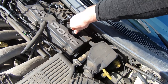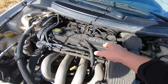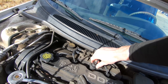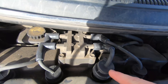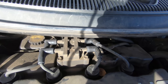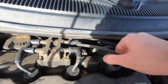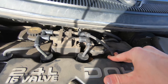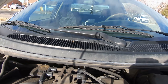All right, so it's running the same when I pull that wire. I actually don't hear any sparks jumping and shorting to that wall like you do on the other cylinders — you can hear how the sparks are jumping there. So I don't think it's getting spark on that cylinder. It should be shorting to the wall here but this one's not giving any spark. I could put a spark tester on there, but I can hear it's not giving any spark. So it's probably this coil pack, unfortunately.